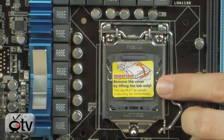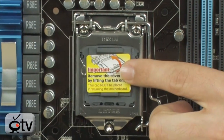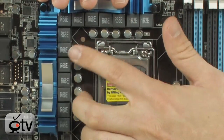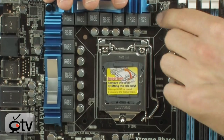It's a bit simpler with fewer features, but you still get all the quality and overclocking ability. Starting with the socket — it's an LGA 1156, supporting Core i3, i5, and i7, so no matter what level of performance you need, you can put in the appropriate processor. Over here you have a 12+2 phase VRM, so the voltage regulators have 12 phases. More phases means cleaner power, lower temperatures, and a better overclock.